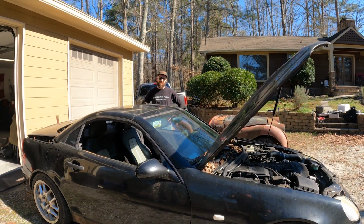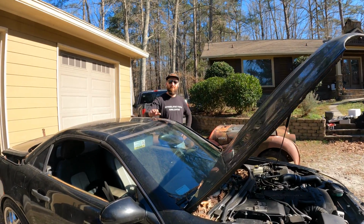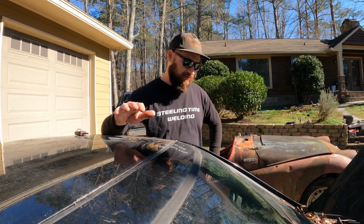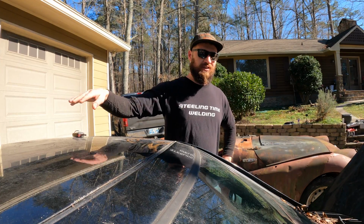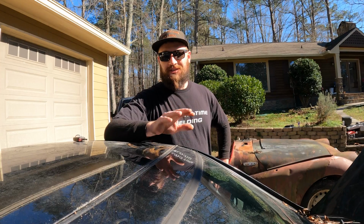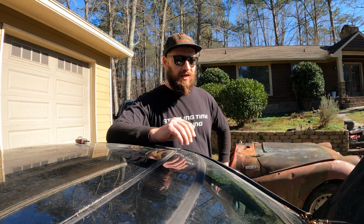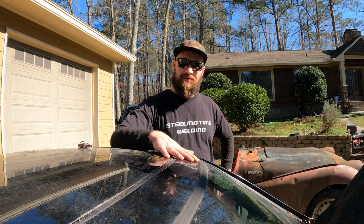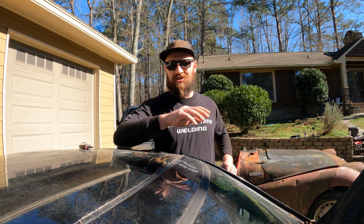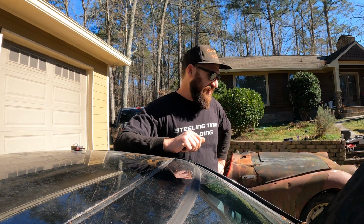So today I think that Corey and I talked, and we were just gonna take the body off. So what we're gonna do with this AMG, because we still do have a lot of good parts on the vehicle, even though it's been T-boned on this side, we still have good stuff around the car. So we're gonna very carefully take off what's still good to use and maybe try to get some money back. But then we're gonna start really getting down into the structural components of this vehicle to see where we can make our cuts, because we do have to shorten the SLK by 6 to 10 inches, somewhere in there, to get the wheelbases to line up.